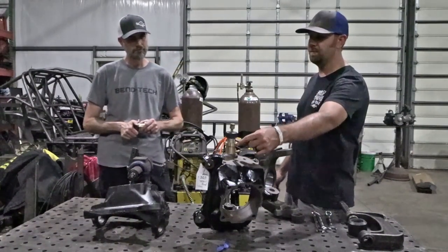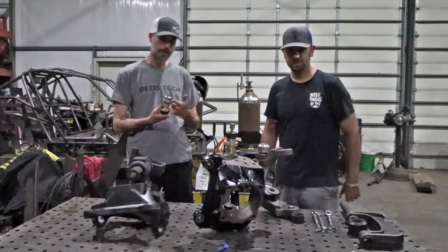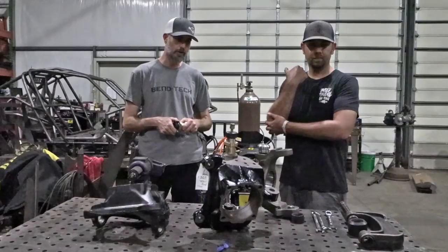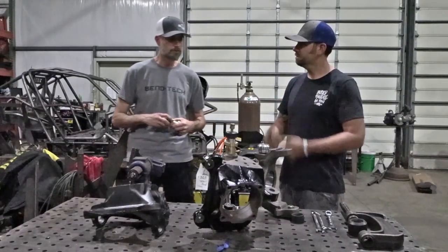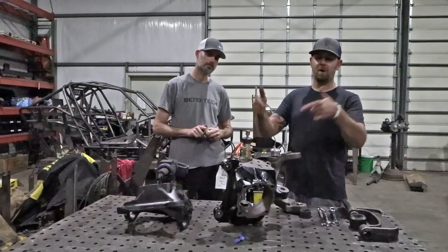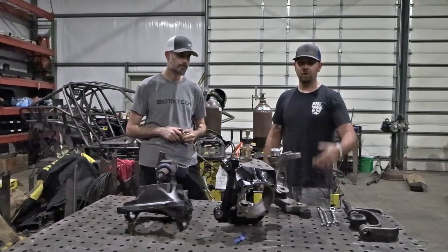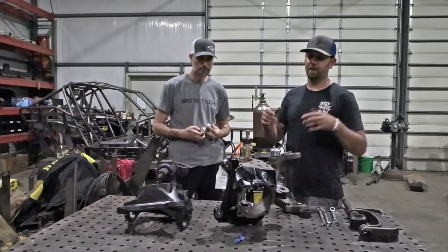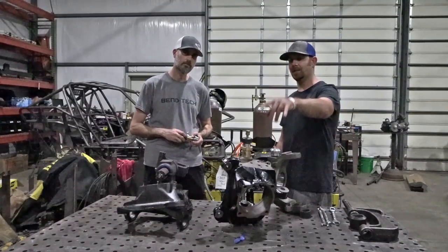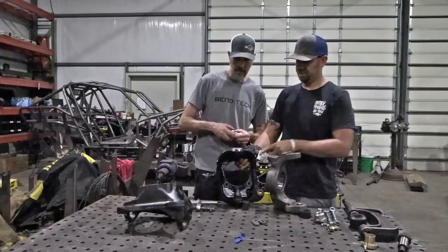If somebody has a high-mileage ball joint eliminator vehicle and needs replacement parts, absolutely — we can get you replacement brass inserts and thread bungs, and the bolts if needed, though we've never seen one of those fail. Just give us a shout for individual parts. Another cool thing about the ball joint eliminator kit is that it allows you to run larger axle shafts like the RCV big bells. With a standard upper ball joint, the RCV big bell rubs on the lower part of the ball joint and can't be installed. This eliminates that clearance issue.